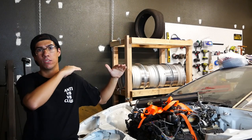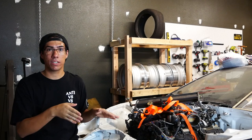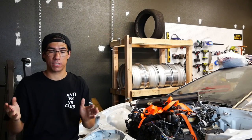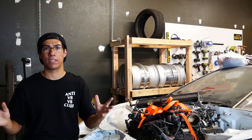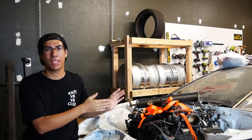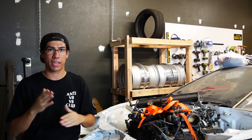The transmission is at the same height, so I made the engine level with that, and it should have had enough clearance to make an oil pan. Performance VH says you can fit their oil pan with their mounts. But when I put the rack and pinion in, it's touching the bottom of the crank baffle, so there's absolutely no room to make an oil pan there.